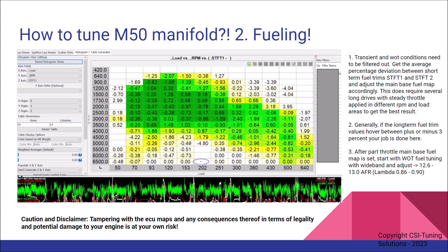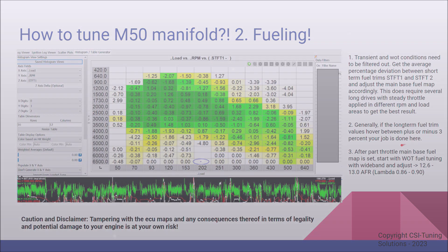Getting the long-term fuel trims exactly to zero with no deviations is not possible, just because of ambient conditions and other factors. There's another method where you can turn off your long-term fuel trim values in the ECU so they don't affect your wide open throttle fuel map. However, for a beginner tuner I would recommend leaving the long-term fuel trims on — they are a good indication of how well your base fuel map is tuned. If you have them turned off and don't regularly log or monitor driving parameters, there is a risk something could cause your fuel map to be off with no indication, since the ECU has limited capabilities adjusting via short-term fuel trims only. After the part-throttle main base fuel map is set, you can start with wide open throttle fuel tuning.